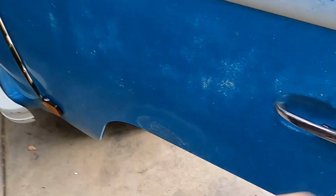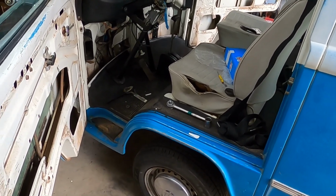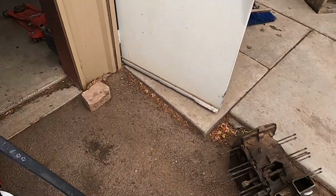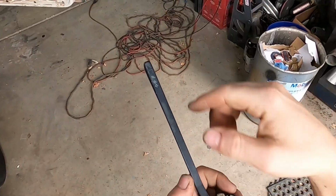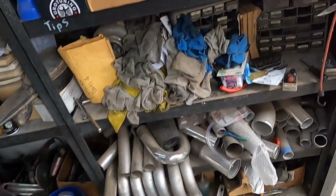And that side is on, so cool. So the switch is working. It must just be the flasher or wiring to the flasher. And I'll put this in my stash of parts because even though these broke off so it can't actually get contacts for the blinker, this whole assembly is still good. If someone has one that's broken off and needs it, just let me know.